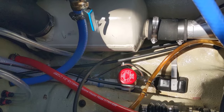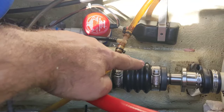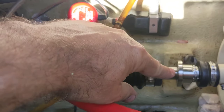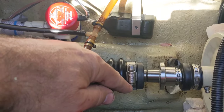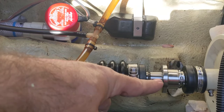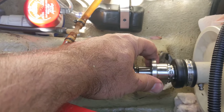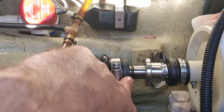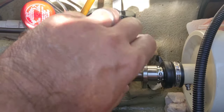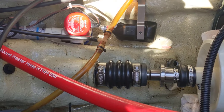Next we're going to take these rubber o-rings and install them inside the metal ring, and then put a little grease in there as well. Now we've got everything put back together — got the drive shaft put in. I put a little grease on the splines and slid it in from the back. You can do it with just one person — just be careful. Make sure the metal ring is on the right way where the flat side is facing your carbon surface, and then this is going to pull up past this groove where we'll put in our new c-clip. But first we need to put our pump back on, otherwise the whole thing will just slide backwards.